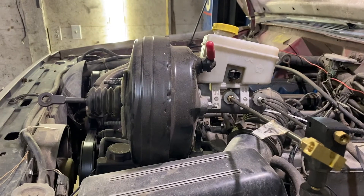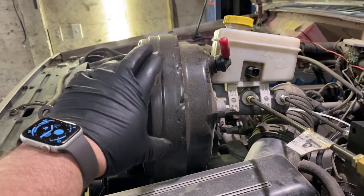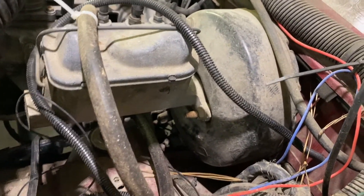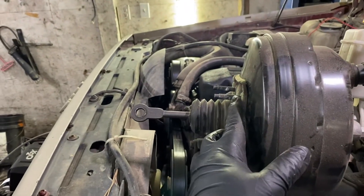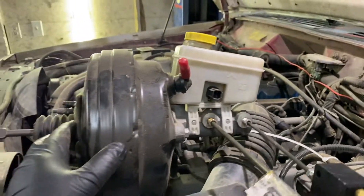Now there are some issues with this. You'll notice that the height on the drum itself — this is the vacuum power assist module — is quite a bit larger than your original OE. When I get them on the bench, I'll put them side by side. And you've got a gang connector right down there, so we might have some clearance issues. We might actually have to space this off and put a little bit of a spacer here to get it far enough away to clear that wiring harness.